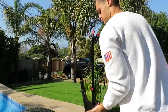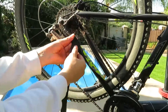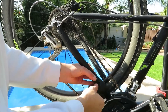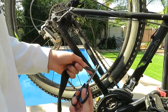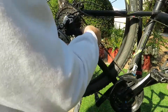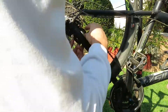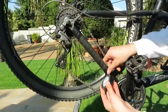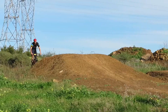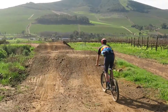You are going to wrap what's left of the tube around the chainstay. Be sure to make a little overlap in the beginning and wrap it nice and tight. Once you've reached the end of your chainstay, make a little overlap to keep the tube secured. Cut off the excess rubber, then take some insulation tape and wrap it around the beginning and the end of your chainstay protector. This ensures the overlaps don't come loose and gives it a nice finished look. In my opinion, it works even better than some professionally made chainstay protectors.